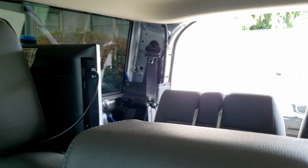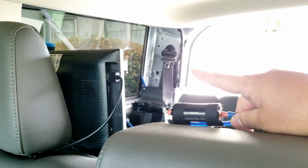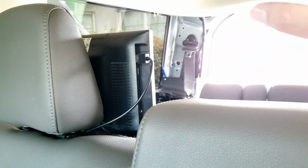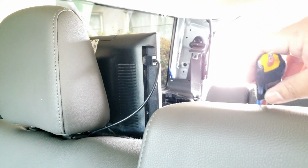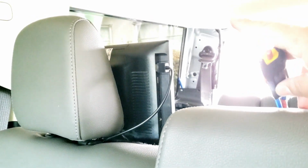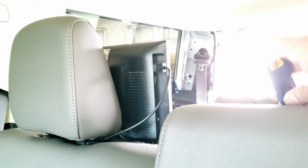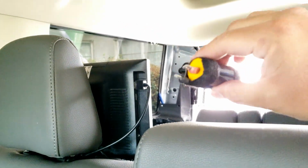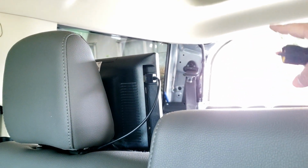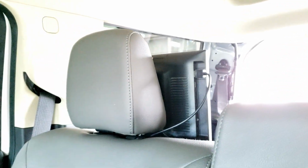So sorry if it looks so crappy. It has to be a permanent connection over there. So this has to be permanently plugged in on that end over there before I can put that panel thing back with the holes already on it, ready for the C7 speakers and tweeters to be mounted in. So I'm probably going to pre-mount the speaker, the 3.5 inch driver and the tweeter onto the D pillar prior to connecting these in, because it's just 3 push pins that connect to that area, and then 2 7mm screws on the edges, one there and one in the bottom there on both ends.